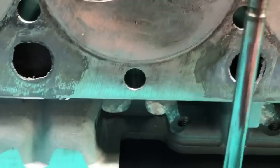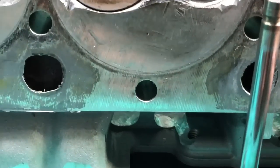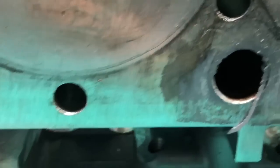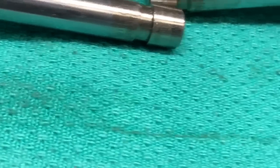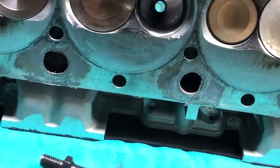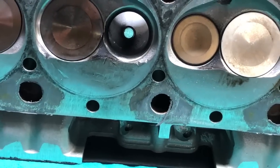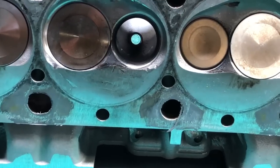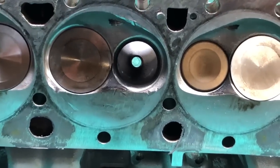This is a valve that came out of the heads a while back when I had a blowup. This is what I was talking about earlier — you can see the height difference of where the lock is, the stem height. The valve I just took out is much taller; it's a couple hundred thousandths difference — kind of hard to see. We'll get Richard to do these heads, get this one cleaned up, get the block and crankshaft sorted, and hopefully we'll be throwing this thing back together soon. If you have any questions or comments, hit them below. Don't forget to like, share, and subscribe. Go fast and get some win lights — thanks!